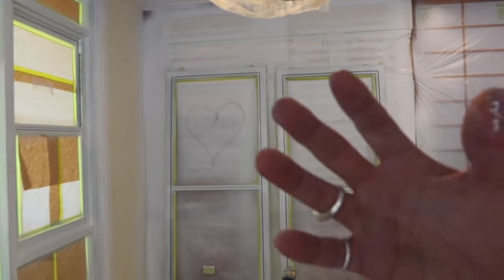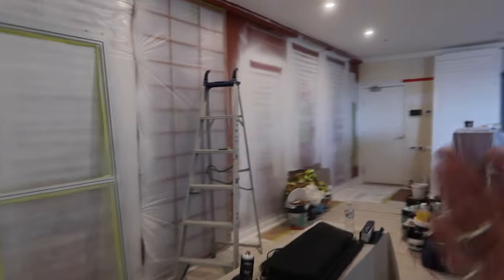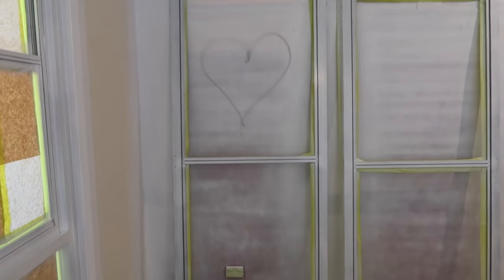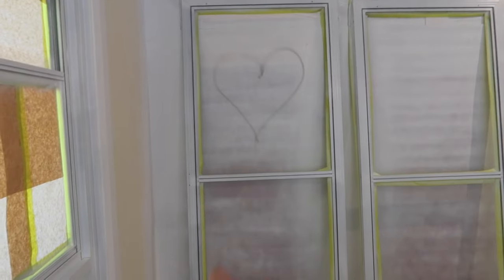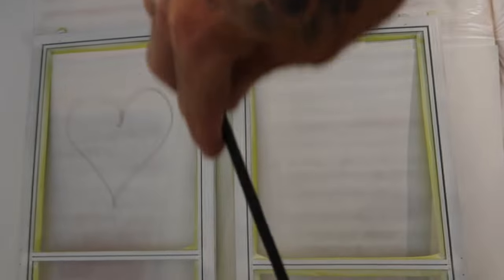Really easy process as well. Anyone can do it. Just follow a couple of videos if you have to, but it's exactly the same. You just got to make sure that your screen's tight, start from one direction, and just pull it as you go around, keeping the tension nice and tight on, and make sure you get no creases. You can get a little tool from Bunnings, just for the rubber inserts, just like a little pizza roller with a little insert in the middle that runs along on each side of this, and just pushes the plastic rubber seal back into place.